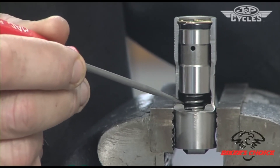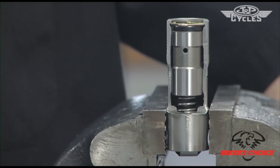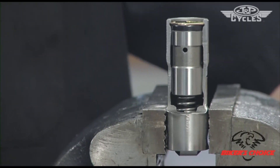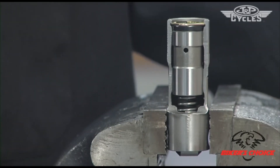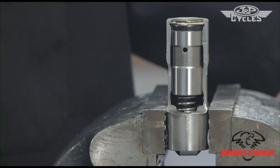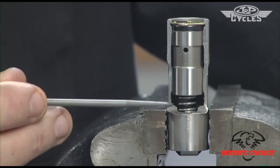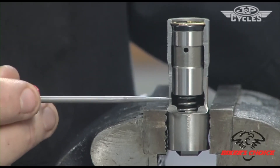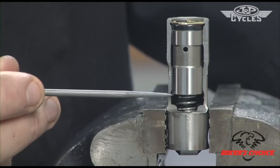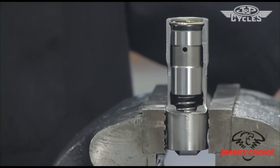What you're doing when adjusting the push rod is closing the gap between the piston and the bottom of the lifter. For the lifter to do its job and compensate for growth in engine height as things warm up, this travel has to change and take all the valve lash so your valve train is quiet. You want to adjust this piston to the center of that travel — if you measure it with a caliper, it's roughly 200 thousandths of an inch, and you want to adjust the piston down about 100 thousandths.